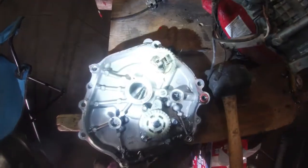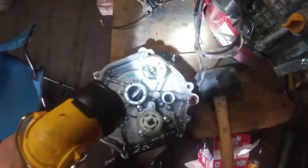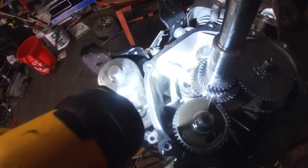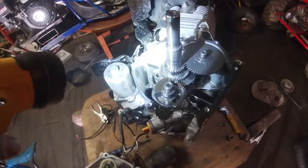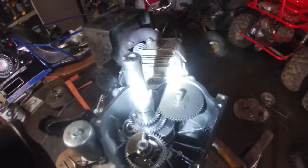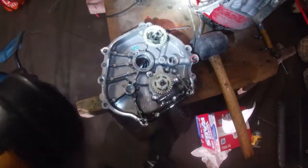All right, guys. So we're back. We took off the side cover. That's the governor right there. We're going to remove that. We're going to pry it out from the bottom. If not, we'll destroy it into a thousand pieces and remove it, clean up all the stuff around it. And then from here, I'm going to use bolt cutters. I got some bolt cutters right there. I'm just gonna cut that off right there, snap that right off, so I don't leave no debris in there. I don't want to use a grinder. And then I'm gonna clean up the rest of the oil. See the gasket still in one piece. And then that's basically it. Same thing as a 420 Hemi.